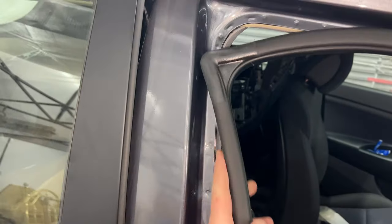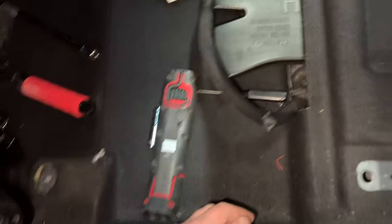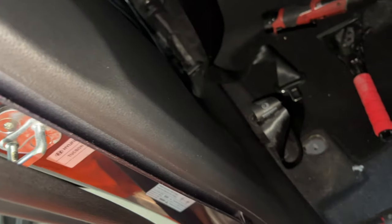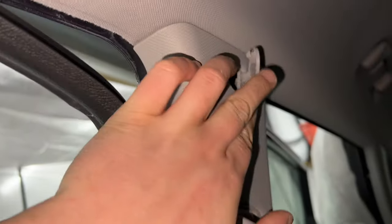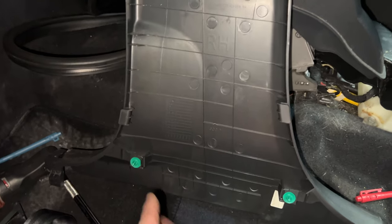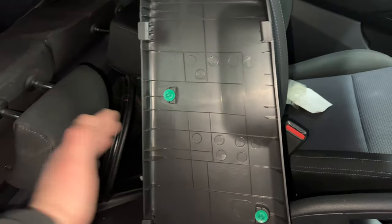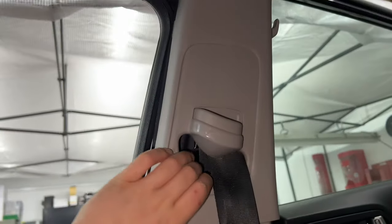First thing — just pull this door rubber towards me, just enough to get into this area. Remove this side trim just here, held on by trim clips. There's one at the back I had to remove as well because this black piece needs to come off. Once removed, this will just pull off — it's on trim clips. You need to remove the black one before you can remove the grey one. The only thing holding the grey one on is trim clips, but there's also a cover just here that says airbag. Get a little tiny screwdriver to pull that out — it exposes a 10mm bolt. Here are the trim clips on the lower B pillar trim: two at the bottom, one here. I've now removed the 10mm bolt and the two trim clips — this whole unit will just pull down. Both B-post trims are now removed, giving access to the seatbelt bolts.